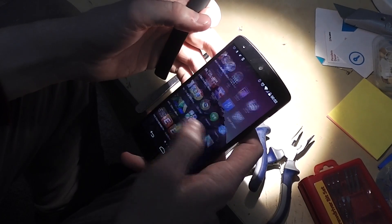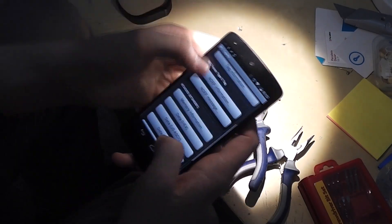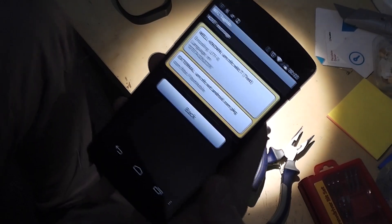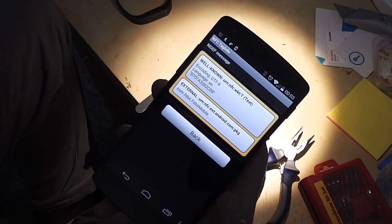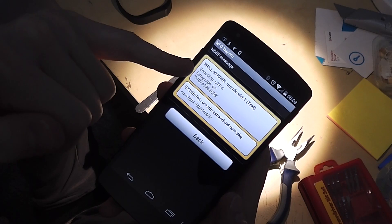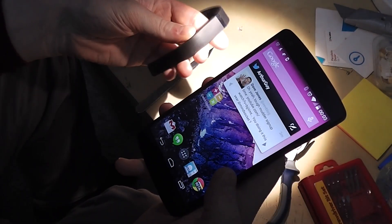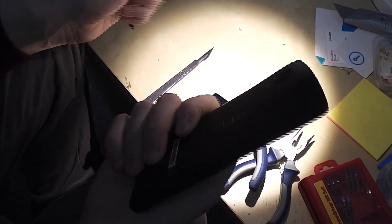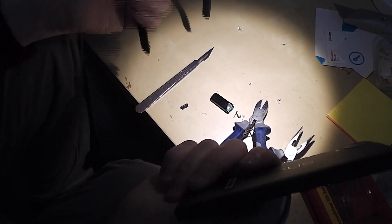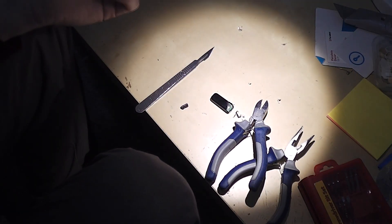It did have that one working as well. If you look at the tag data, this is what I pulled up a little earlier. We've got two bits of information in here: it fires up an application and it also contains a string — I'm fairly certain this is the MAC address for the device. This might be used during setup within the application, or it might be a feature not quite fully implemented, or maybe it is fully described and I'm just not aware of it. But there's certainly the possibility to set up and expedite the configuration and synchronising of this device, so if there are a lot of devices in proximity it knows the MAC address and can trigger the right process.